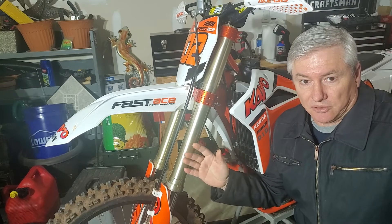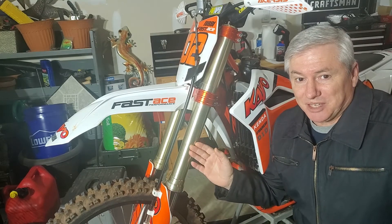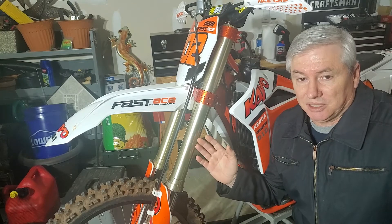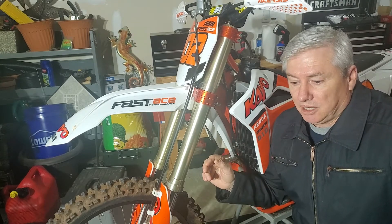If you can find these on eBay — I got a really great deal but I've had them for over a year and a half. I had to rebuild them totally. Anything you're buying that's from 2004 to 2008 that someone else hasn't already rebuilt, you're going to need to rebuild them. All the bushings, seals, and oil had to be changed out.